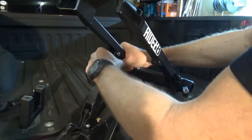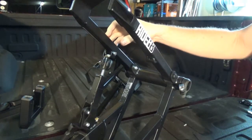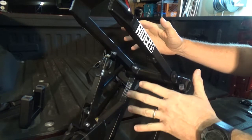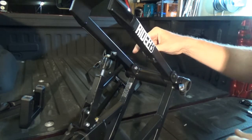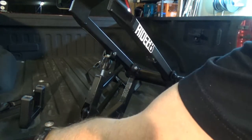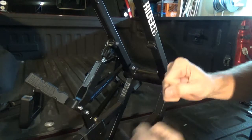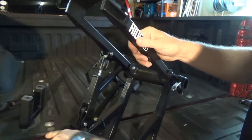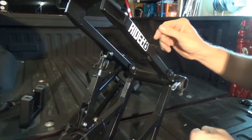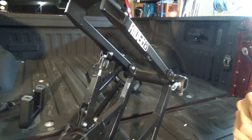Check it — nothing's wiggling around. A very important thing about this rack system is that everything stays tight based on the nylon washers throughout all of the hinges. Those allow the rack, when you lift it, to stay up so that it doesn't fall down on your tire while you're trying to handle your bike with two hands. That tension is important. If it starts to loosen up, just slightly tighten the bolts — not a lot, just enough that it holds itself up. It may need a little adjustment throughout the years.